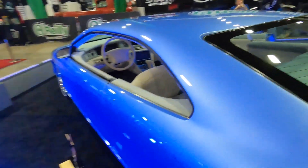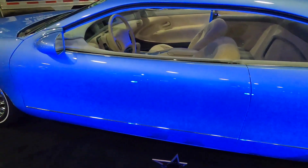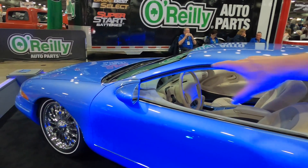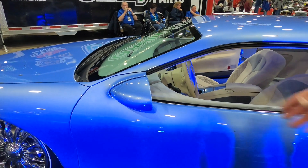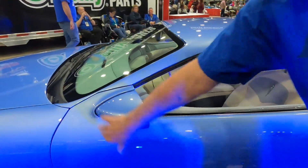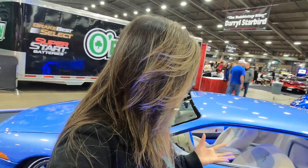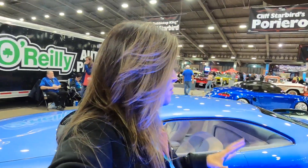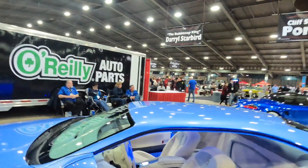What have you taken off from the sides? There was a three-inch rub strip that went through here recessed into the body. We took out that recess and built our own chrome onto it. The side mirrors were actually chopped three-quarters of an inch to make them shorter, because when you chop the car this much the mirrors looked a little too big. Then we recessed the mirrors in around the outside. Looking at it, I feel like — spaceship, limo, luxury car — it's sleek. There's a lot happening here but it's hard to pinpoint it unless you stop and actually have a chat.